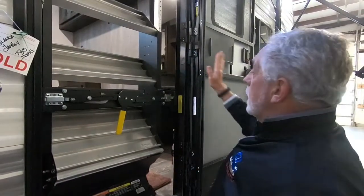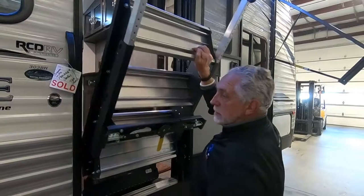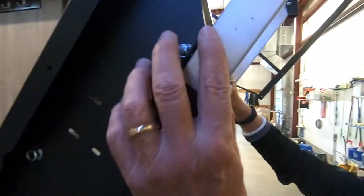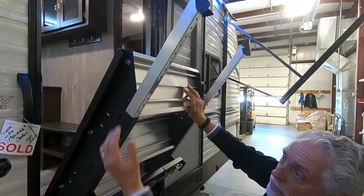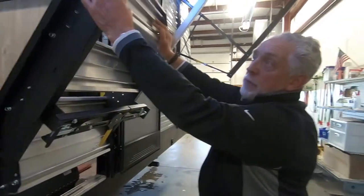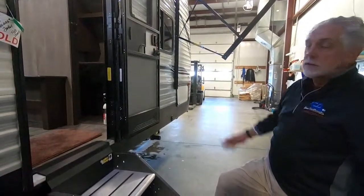When you get where you're going, get your door all the way open, get a hold of your steps, release the latch, and bring it out. It's not a spring assist, so it's just going to come out as much as you let it — don't let go of it or it'll come out and smack you in the head. You've got two little pins, one on each leg, so you can adjust each foot individually. If the steps are banging every time you go in and out the door, you can pop that pin up, adjust each foot, and make it sit level.